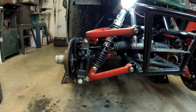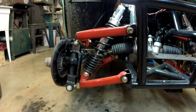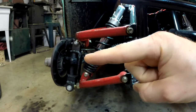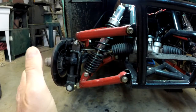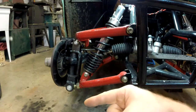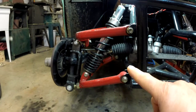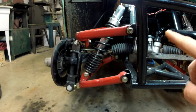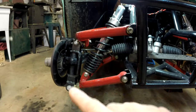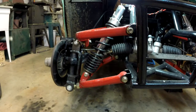The real challenge I found was the steering. When I first mocked it up on the workbench, I ran it through its travel cycle and measured what's called bump steer — as the suspension travels upward, the steering rod affects your toe angle, steering in or out. You want no bump steer; you want the geometry to stay in the same plane. But I had mounted the rack much lower on the frame because it was convenient. I welded everything in, put it on the ground, compressed the suspension, and had about three inches of bump steer. I thought I was close, but I was way off.